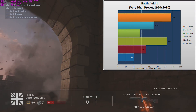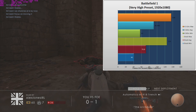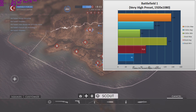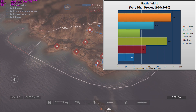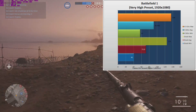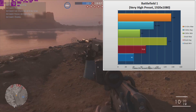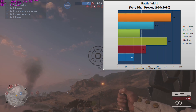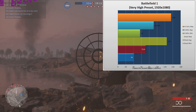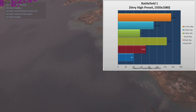For all of today's game tests, we did overclock the FX6300 to 4.5GHz on all 6 cores. This is very easily done, and a quick Google search will show you how. It is actually unbelievably simple to overclock this chip, a lot easier than I was expecting. When I was fighting with the 1055 trying to use front-side bus overclocking, I ran into nothing but issues, but with just clicking the multiplier up a few times, we were able to hit 4.5 and it ran perfectly stable with a minor voltage increase. I definitely recommend this board and CPU together — we were using the Gigabyte G1 970 Gaming, which is an awesome board for overclocking and gaming.